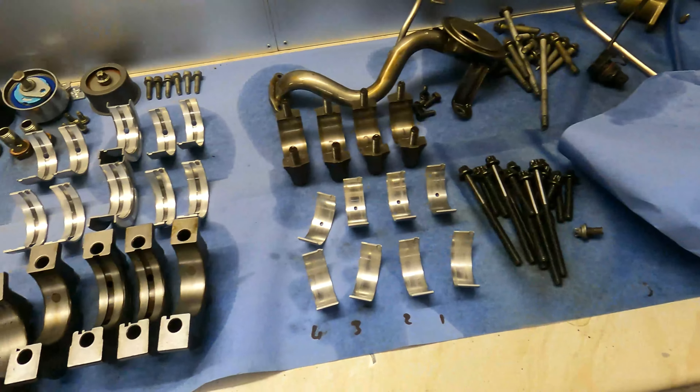We didn't have to break the rest of the engine — left the whole rest of the engine all together, just managed to do it all at the sump, which is great news. Got no bits left over. I put the other oil level sensor in because that was leaking out of the plug itself — there must be a little crack. New copper washers for the oil cooler, new seal for the sump pickup, new filter and bearings. We are all back together. I'm going to leave this upside down overnight for all the sealer to go off so it's not submerged in oil.